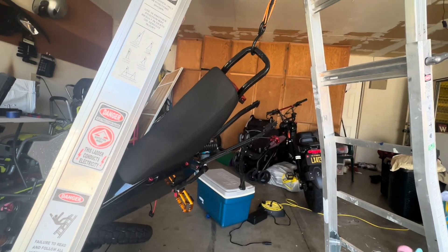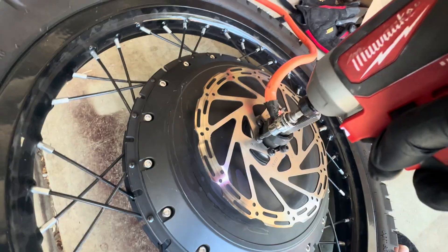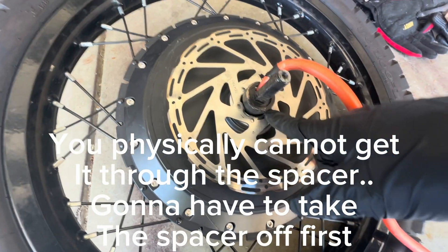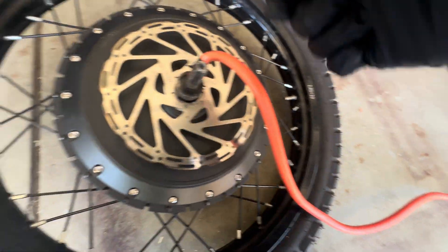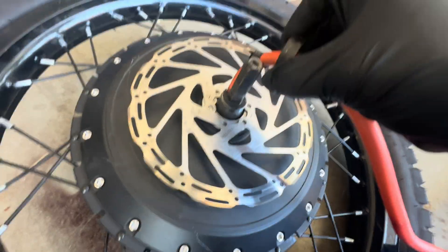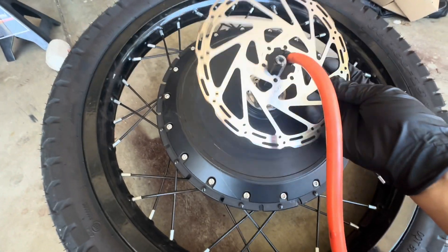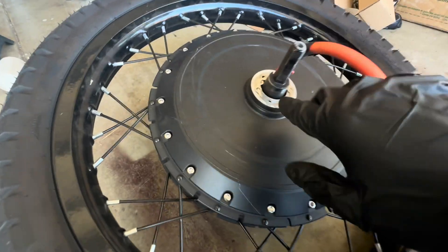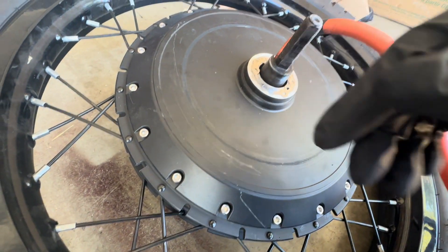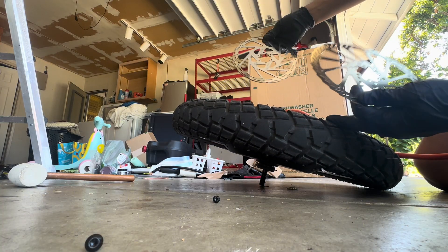Oh my god, I messed up a lot. So you hit these with a 4 millimeter, then thread it through the spacer and through the wire, pop that out, and roll in your new brake. With my dumb ass, I wasn't using my brain — you're gonna want to fish this out first, then it'll just come out no problem. I had two spacers there — gaskets, whatever. I'll leave that there. There's no directional arrow on them.